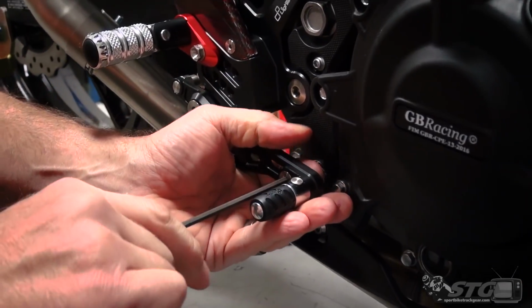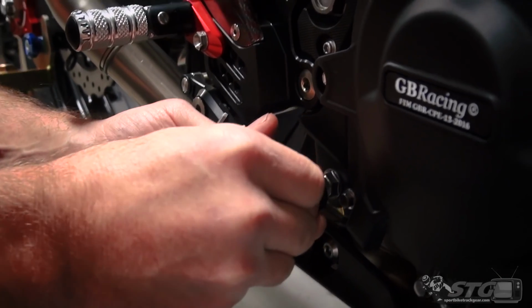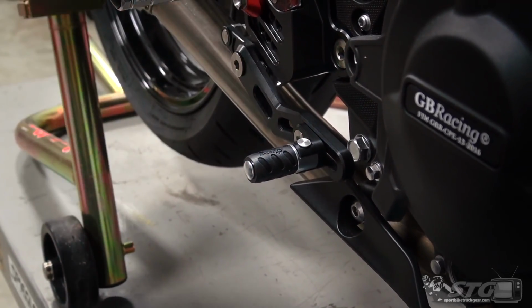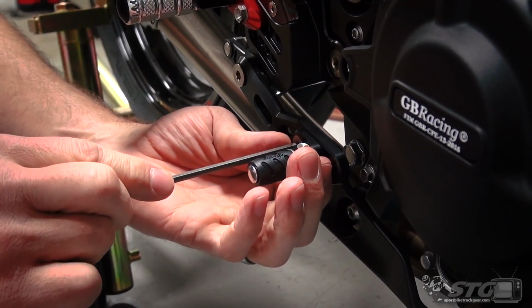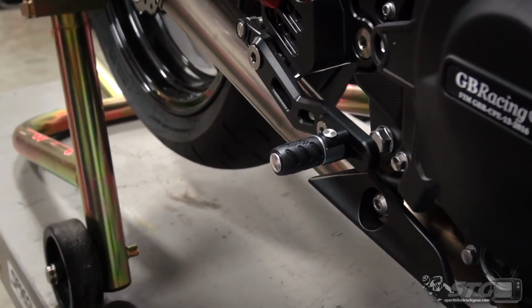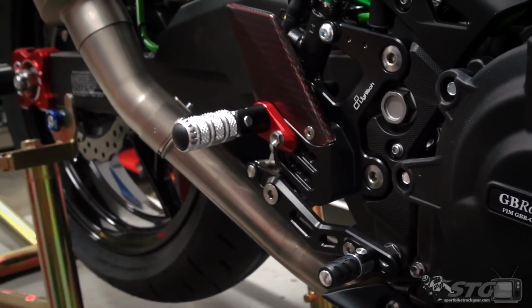It's got a 4mm T-handle. The lock nut, and they use a nylock nut on the other side, is actually captured in a channel. So moving this is really that simple. And that's a great way if you want to make fine adjustments to the length of that brake lever. You're talking 1 fastener, and that's a tapered seat fastener with a lock nut. Torque that down. Folding tip, folding peg.